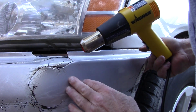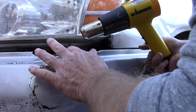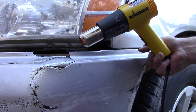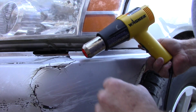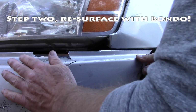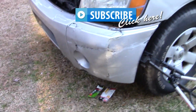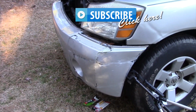This plastic is badly misshapen. This is the worst junction of the damage right in here. So kind of a horseshoe effect here. Very difficult to tack all this together, and at the same time I'm reshaping the plastic to this three-way joint that it was originally. Well, that's just about got it. Alright, so I'm getting there. We have what looks to be a scratched up bumper now. And it will only get better.